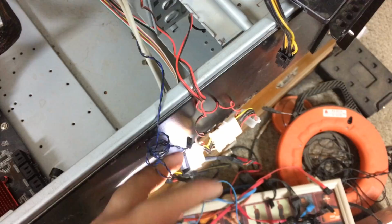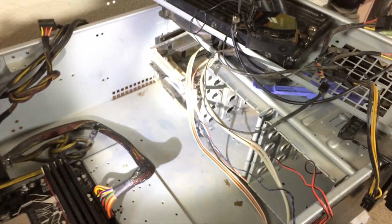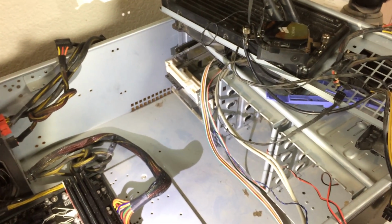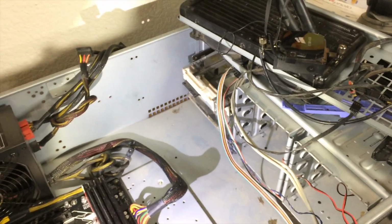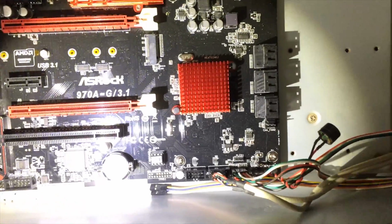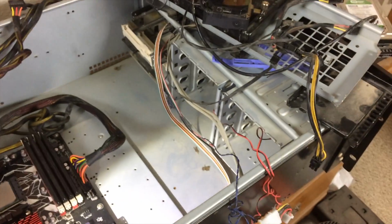There are two of these sort of purple and black cables, which are labeled hard drive LED. Those actually connect to the hot swap bays in the front of the case. I'm not going to use the LEDs on them though. I won't be using them for hot swap while the machine is running, so the LEDs wouldn't do me much good. Plus, I've only got one section of hard drive LED connectors, and I'm using that for the chassis connector.